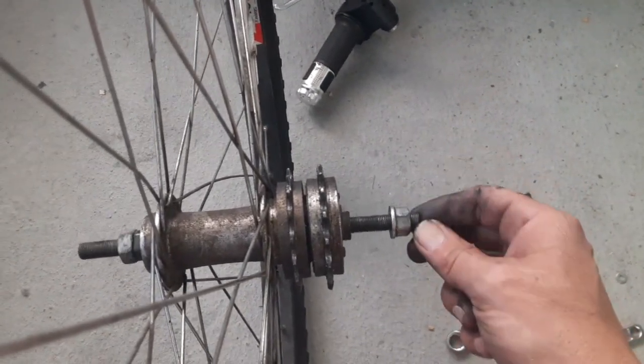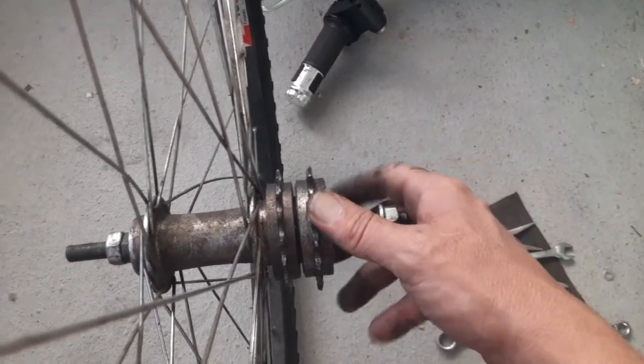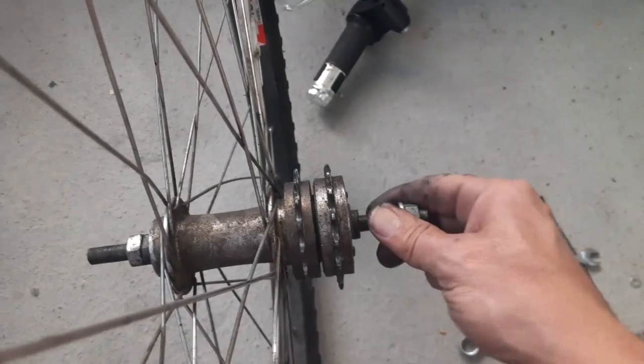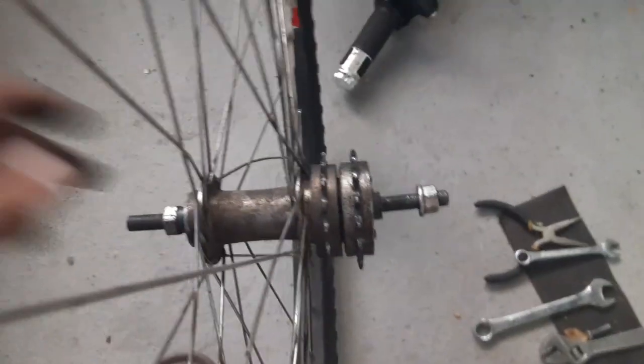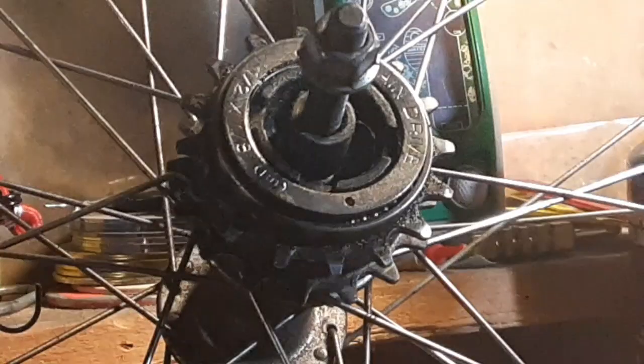This is the problem: the rear axle has bent, and one of the spacers probably jammed itself up into the freewheel. When it jammed up into the freewheel, it jumped the threads on the adapter going into the other freewheel — it's basically all trashed. Pretty good amount of carnage here.